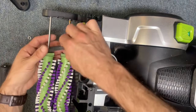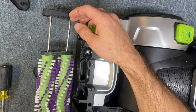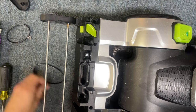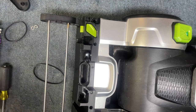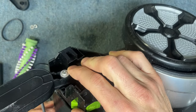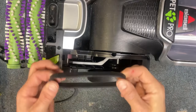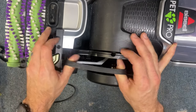In my experience, it's been very rare that this belt ever breaks because this one just connects the two. But if you do pull these out, I'll go ahead and show you how to put it all back together. One thing you're going to notice is you're going to see these little stainless steel washers — there should be four of them, so you want to hang on to those. If you wanted to, this assembly here can come off as well by removing this screw, and then you can take this whole assembly off and clean it, but you can also clean it in place.